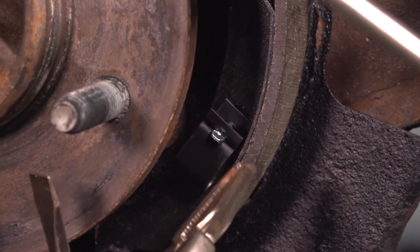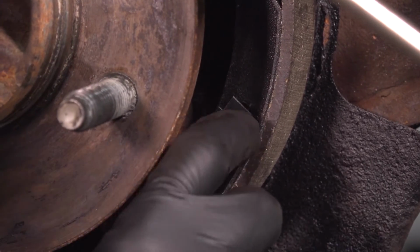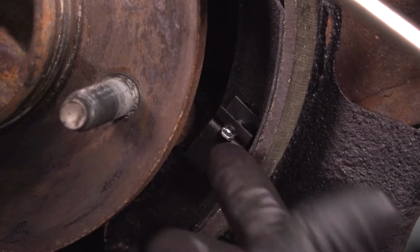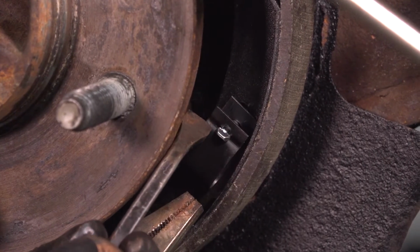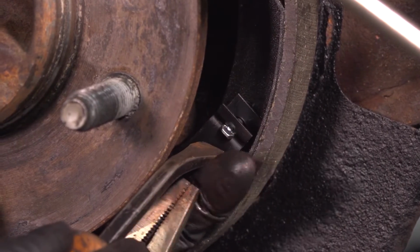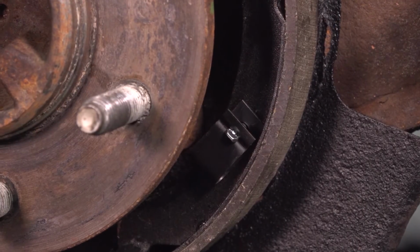but a lot of times that gets complicated because not only could you rip the head off of this pin, but it could also just spin the whole thing over and over and over without actually turning just the pin and locking it in. So try your best to put pressure just on the side of this without slipping, of course, and then from the back side, slowly turn the pin until it locks in. And do the same to the other side shoe.